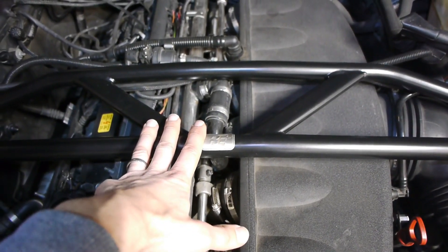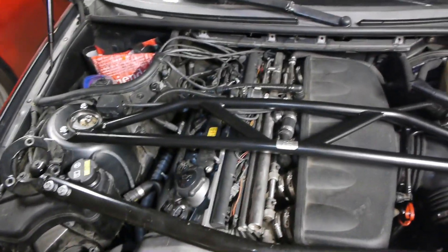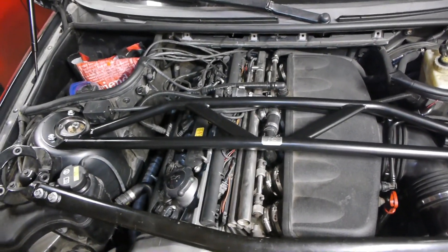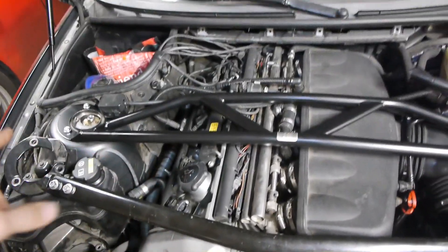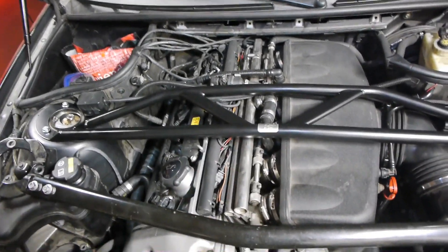The Rogue bar is a much better piece but it is much heavier — about twice as heavy. The stock one is about three pounds total; this steel one is about five to six pounds. I'll explain why I got steel and not aluminum. There's something called the coefficient of thermal expansion — aluminum expands a lot more, and given this is the engine bay, things get pretty hot. When you mount the aluminum version and run on track, you'd actually have some expansion, so the towers would flex a little. The steel one has a much higher resistance to thermal expansion.